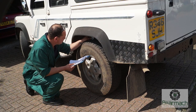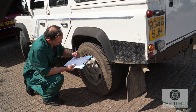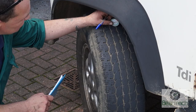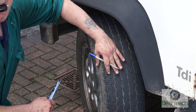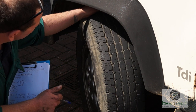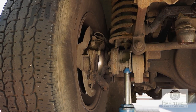After walking around the vehicle and making sure there's nothing loose, the next thing to do is check your tyre tread depths with a depth gauge and write them down — keep a record. Also make sure there's no damage on the sidewalls and the wheels are not cracked. The minimum tread depth is 1.6mm throughout a continuous band across the central three-quarters of the tread breadth and around the entire circumference of the tyre. Check tyre depths and inspect for damage when you turn the wheels; we'll do this more thoroughly when we jack the vehicle up for the front and rear axle check.